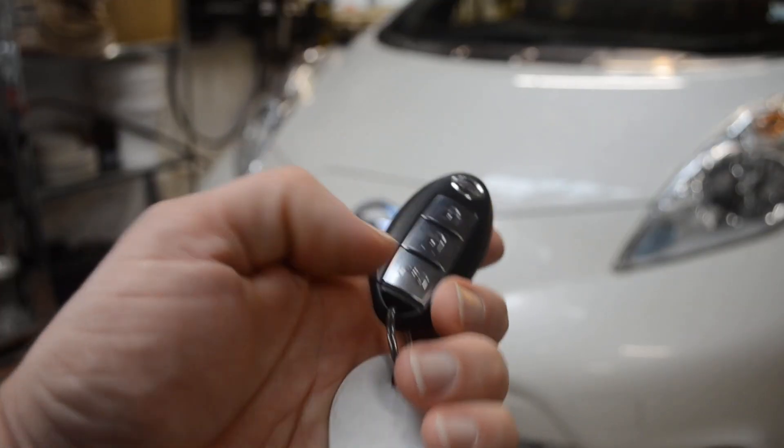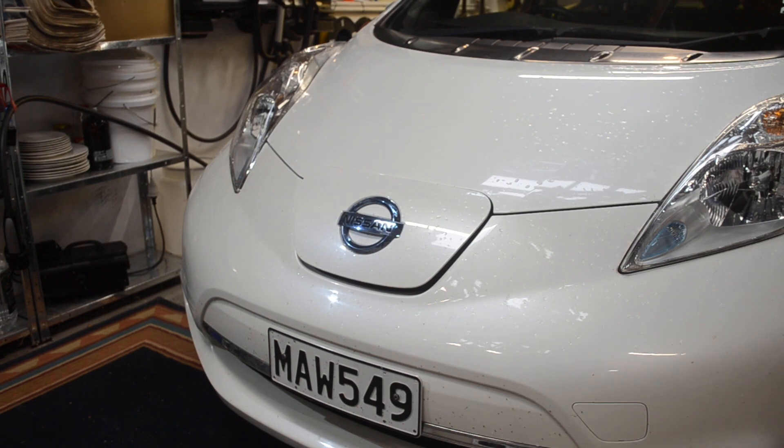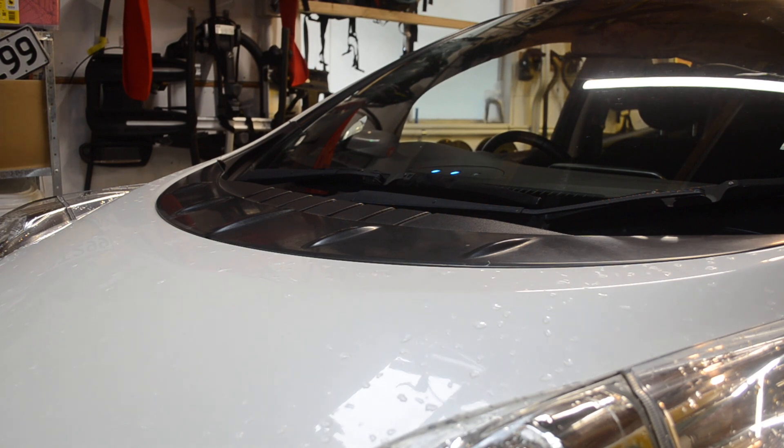Home charging is super easy. You open up the nose and flip the switch. You plug your EVSE into the wall — if it has a display or lights, they will light up. Then you plug the socket into the smaller port on the front of the car. If the car beeps, it's accepted the charger and the three blue lights in the dashboard will start to flash. If they don't, make sure your EVSE is switched on at the wall and reseat the plug in the car.